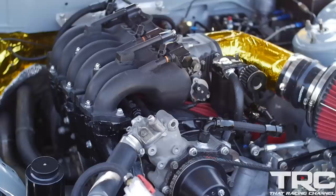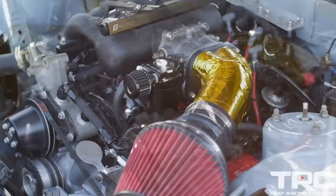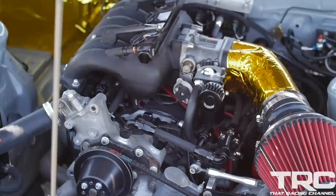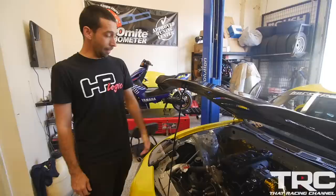The core of the motor is using 9.7:1 compression rotors, which is up from the typical lower compression rotors for turbo. So it's got a little higher compression. It has ceramic apex seals. It has everything. The whole rotating assembly was balanced by Carlos Lopez, a real famous name in rotary engine building. This being a tri-rotor, it has three rotors. You can tell by counting the intake ports or looking at the rotor housings.